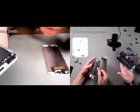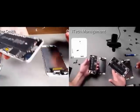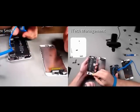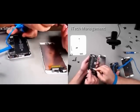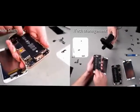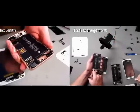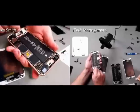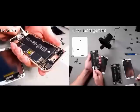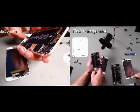But even with just the body of the frame, you can really feel the difference in the weight. Now, those there, you've got to peel back, and there's strips of adhesive running all the way up that you have to pull out. So one thing you never want to do is dig around these batteries with anything metal. I've twice now seen them catch fire in front of my face. So if you saw me digging with metal earlier, that was a mistake.